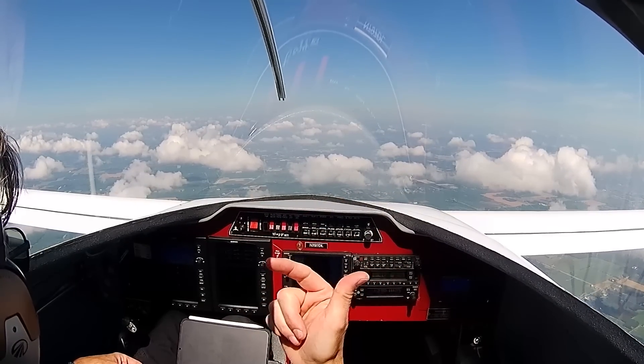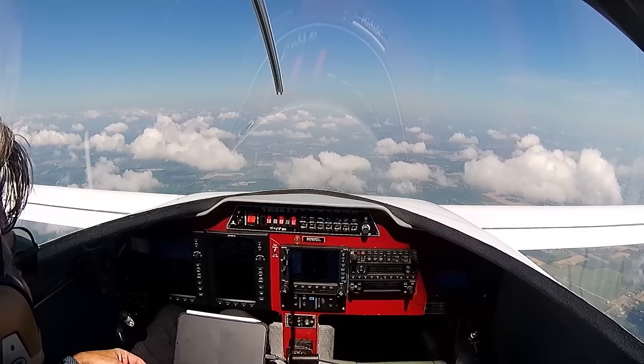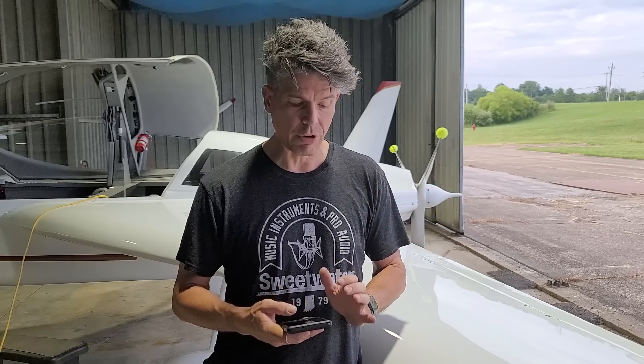By turning off the manifold advance, my airplane actually has more power — it's flying faster and running cooler. So I had two timing problems: the EIS and the magneto. The magneto got fixed at the annual inspection. At idle, the electronic ignition was showing 45 degrees before top dead center — way too high. At static full power run-up I was getting 2180 RPM with 51 degrees before top dead center — astronomical, should be nowhere near that high, maybe 30 at the most. When I switched off the manifold pressure sensor, I gained RPM, going up to 2230, and timing came down to 35 — still a bit too high, but better than 51.